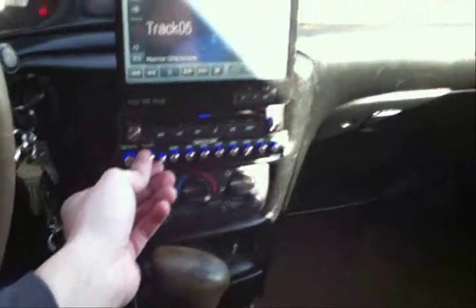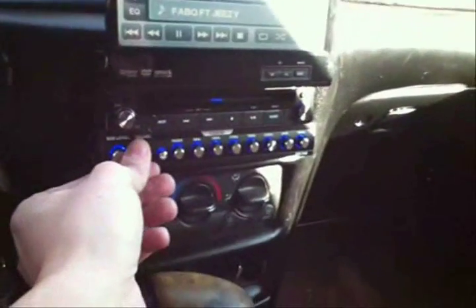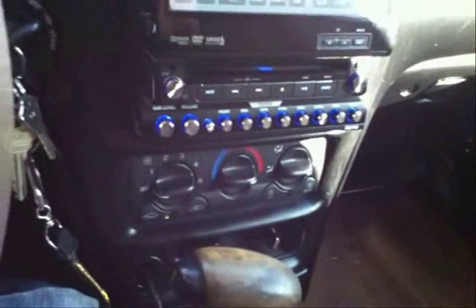You guys have heard that track in my stereo before, and it sounds pretty amazing. Eventually, this will get trimmed, and it'll get molded into that panel, but it'll also be cut right there, so the motor can fit better. And it's the same thing with the tape that is on there for the installation. I learned that from Matt Bogart when he was putting in his Image Dynamics horns. He said that metal shavings could get on them and then get inside the diaphragm. I didn't want that, so I went ahead and taped them, but I just haven't taken that tape off yet because it's been extraordinarily cold. But let's get some wrap in here.